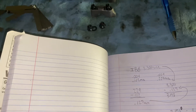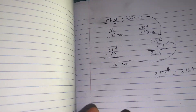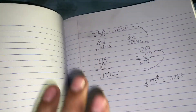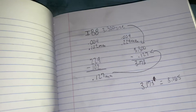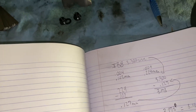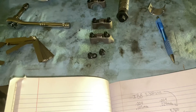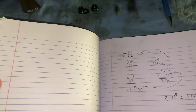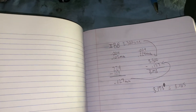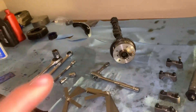I really hope this helped you guys out. It helped me and I got all my sizes correct. For bucket lifter number eight, I ordered that size — when it gets here I'll swap it in and double-check it. It's crucial that you check your valve clearances because if not, you're going to have an open valve, lose compression, and that's the last thing you want. That's how you check your valve clearances and get the correct size.